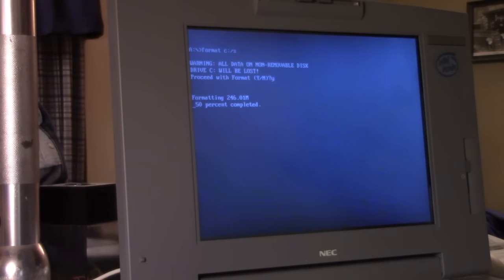I found that the drive had bad clusters, and I explained to the owner that you might want to tell your daughter to just use it on a desk, not on the sofa, because kids don't know how to properly handle sensitive electronics like these old laptops. Modern laptops will instantly park the heads if they sense any acceleration or sudden movement. But this laptop didn't have that feature. That hard drive didn't have the auto park feature, and the laptop did not have a 3D accelerometer to determine its position. Neither did these older ones right here.